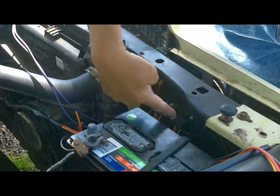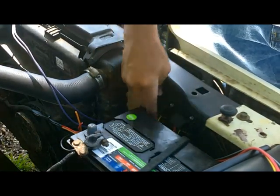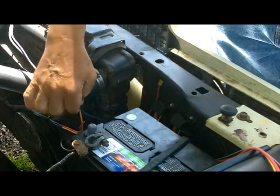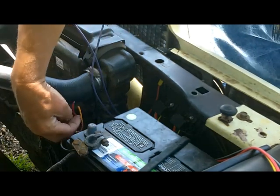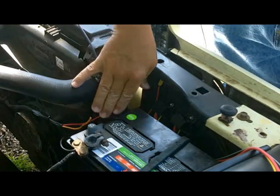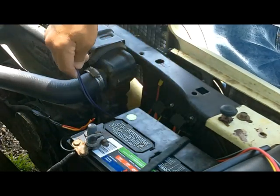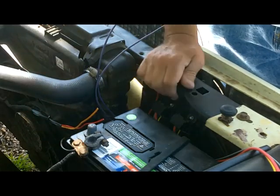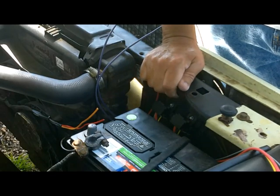Okay, so we got our two relay mounts — or relay receptors — mounted, and I can still reach up in here and push my relays in. It's real close, but it'll work. We've got the two leads here; these two purple leads will get connected to our two leads to our fan. These are separate — each fan is separate. Got to cut these off and splice these in. I always hate cutting new stuff, but it says mount them as close as you can, so that's what we're going to do.